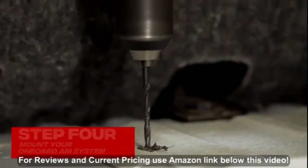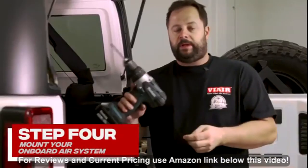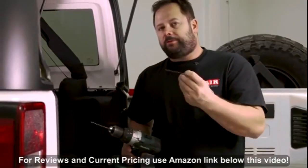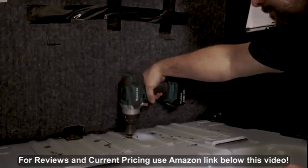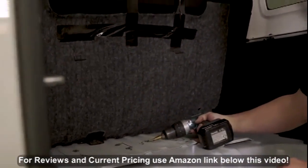To make things a little easier, I went ahead and used a 3/16 drill bit to drill my pilot hole, then I'm going to step it up to a quarter-inch drill bit to drill out the hardware for the compressor. I'm going to do the same thing over here with the 3/16 again for the air tank, and step that up to a 5/16-inch drill bit. The last hole will allow us to slide these connectors through.